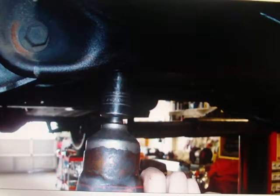Next we go underneath with an air ratchet, and we're going to undo the bolt that goes through this bushing on the steering rack. I pointed that out in the beginning. I said this is where the bushings go. Well, these are the bushings on the old one. You come underneath with the socket of appropriate size and undo it. Do each side. Here is the bolt.